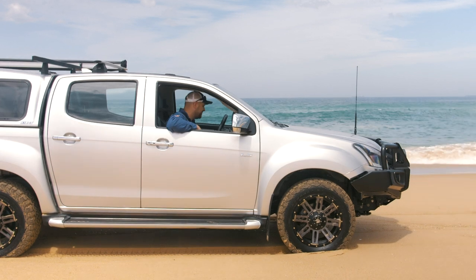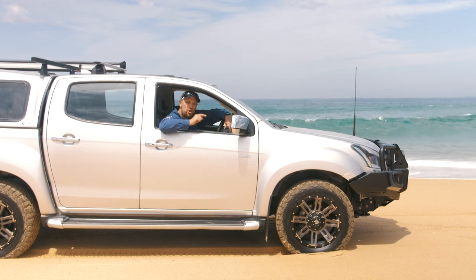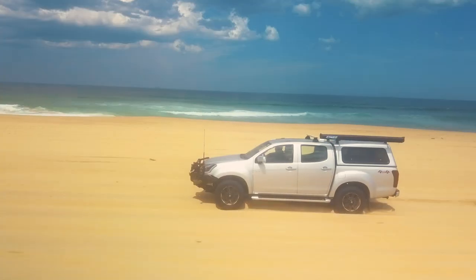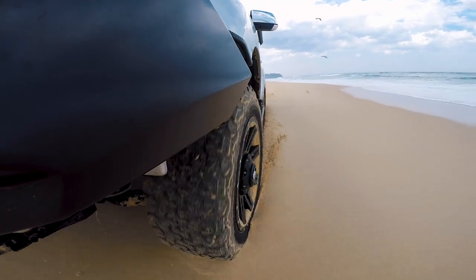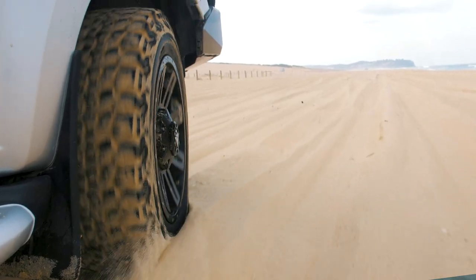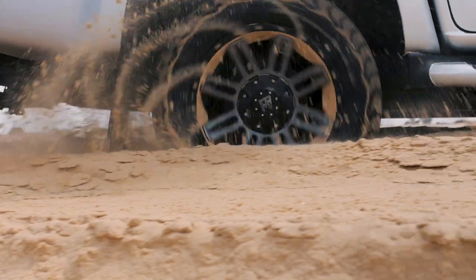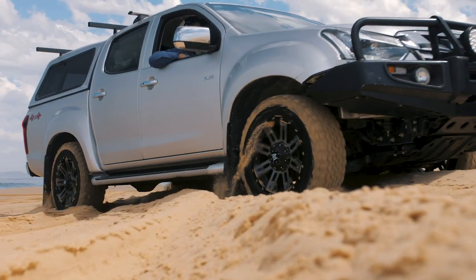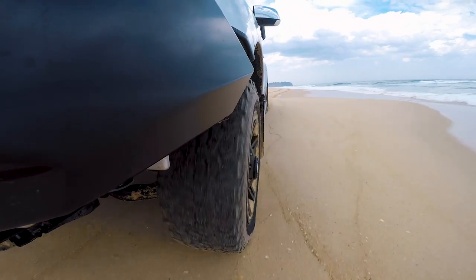And there you go — the proof really is in the pudding. Lower tire pressures massively increases your vehicle's off-road ability. So remember: 16 psi on the sand, 20 to 22 psi up in the hills, and 28 psi when you're out touring. And one final piece of advice — air expands as it heats, and that means your tires are naturally going to increase in pressure as the day progresses. So keep an eye on your tire pressures throughout the day and lower them down again if necessary. For more tips, tricks, and techniques to become a four-wheel drive guru, make sure you hit the subscribe button, and don't forget you can stay in touch with 4WD Supercentre on our Facebook page, Instagram, Twitter, and on 4WDSupercentre.com.au.